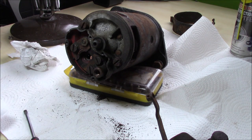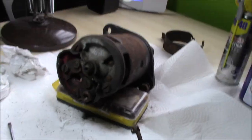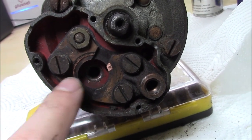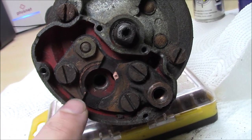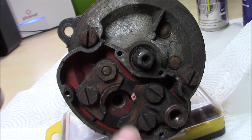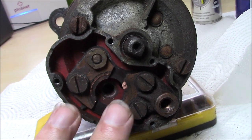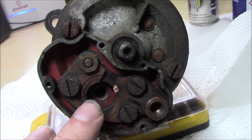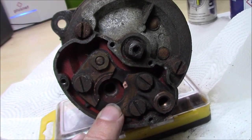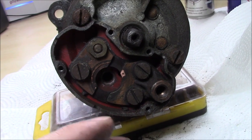Whatever it is that's inside it, it's sort of greasy and powdery and rusty. So when you pull the lever on the starter, there's a disc that contacts with these two plates here. And you can see these are very dirty. They have been making a point of connection here, and we had found that when you'd done a few starts and everything was sort of run through and being reliable, this would start very reliably, but it very often needed a knock on the casing to get it to go. So we suspect that's because this area is not connecting very well, and in part because the brushes are very stuck.